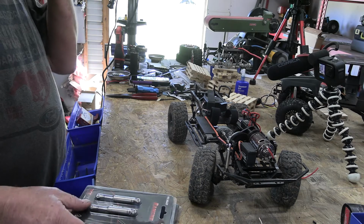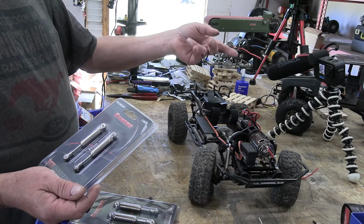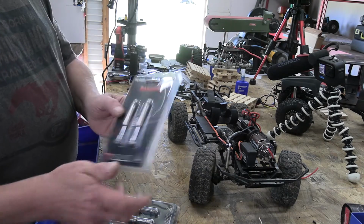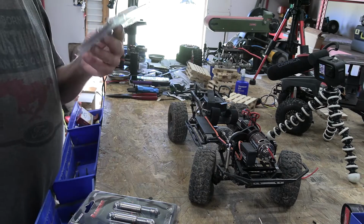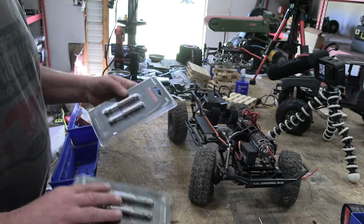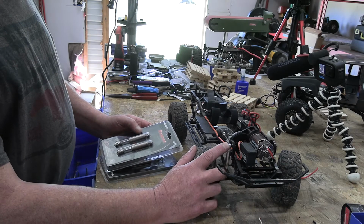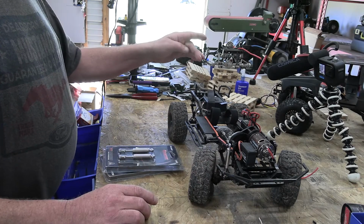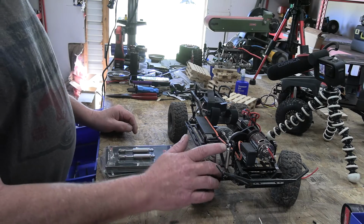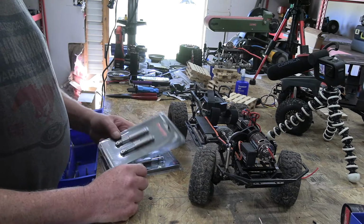Okay, so what I have here, I put the 90 millimeter on the extended cab, long wheelbase, and I have some 80 millimeter right here. And I also have more boots, of course. But originally this truck came with 70 on the front, and I believe it was 80 in the rear. So what's going to happen here with these shocks, it'll at least lift it up 10 millimeters.